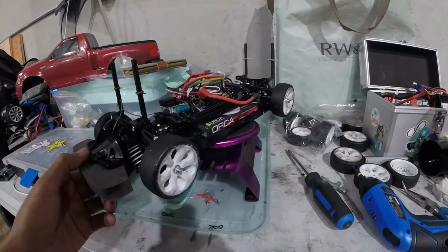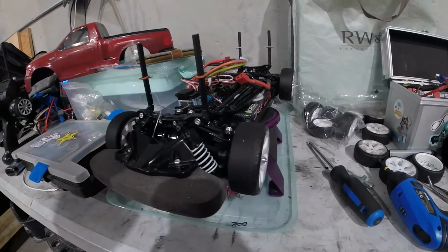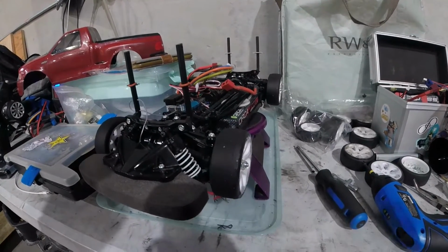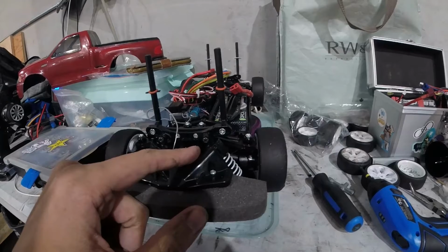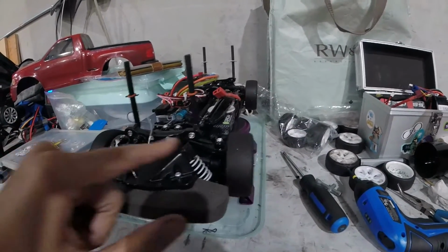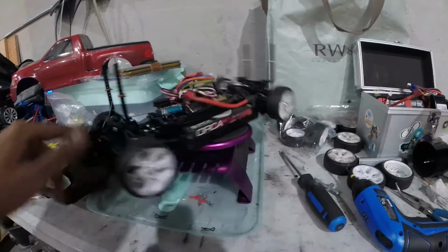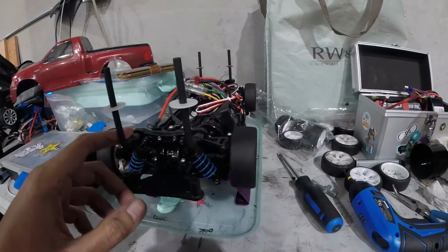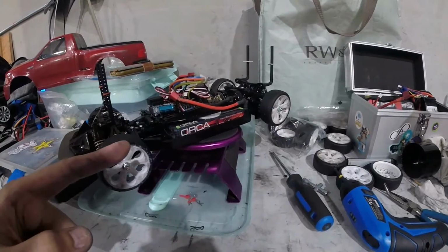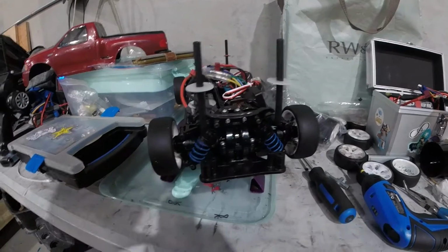Yeah. And we got the white springs on, like I said I was going to do. One of the next steps here, instead of switching up the springs, because I think I'm getting close to what this car likes for springs, is to start messing with the only other adjustment here, which is the shock angles. I can adjust the shock angle one notch in on the front or rear, and I might start playing with that. I'll come back and explain that when I'm actually playing with it. Yeah, let's go run after I cover these shocks in grease on the inside.